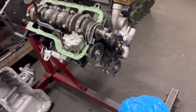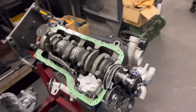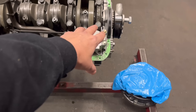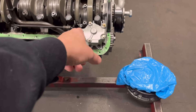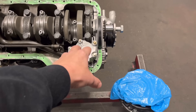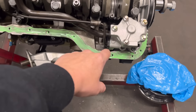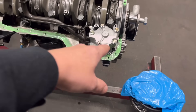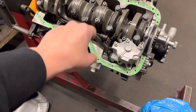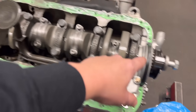So what am I doing this morning — this Cosworth here. I've got the cylinder head on and the big old blower. What I'm doing first is the new oil pump. I always take the top off the new oil pump, check, make sure there's no flashing in the castings, make sure it all turns nicely, prime it all up, put it back together. We've got the new gasket with the pickup, and the pickup is all on and cleaned. I use an anaerobic sealer here because this is a four-wheel-drive with no gasket — we've just put our seals in at either end.